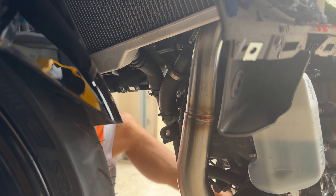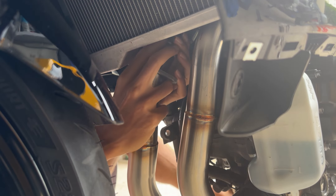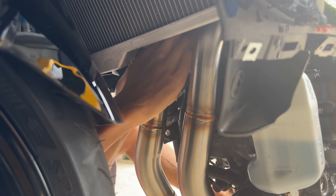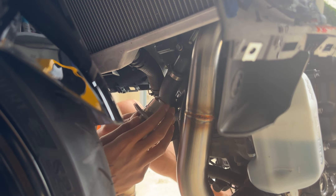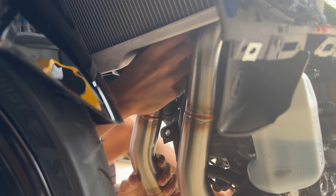Now I'm going to put in number two on the second side. Notice right here — I have the gasket for the header right there. I'm holding on to it and putting it all in in one go, because I didn't have any grease or anything to keep it stuck. Just in case any of you guys don't have anything to keep it stuck in there while putting in the header, you can hold it and put it all in at once — it's very doable. There we go, gasket is in.